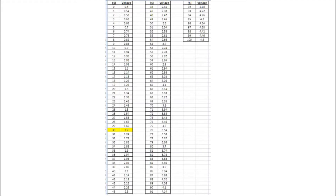Once you measure your voltage at the sender, you just match it up on the chart to see what the sender is actually telling the gauge. In my case I had 1.7 volts — you can see that corresponds to 30 psi — and it should have been more like 2.5 volts. So that was a pretty clear indication there was a problem with the sender.